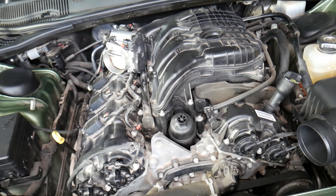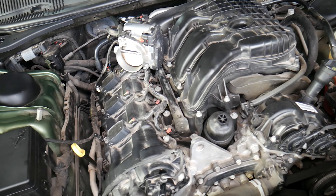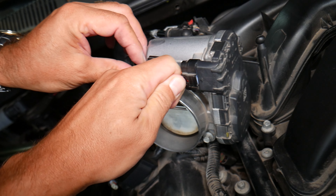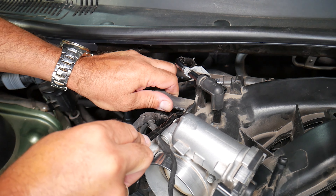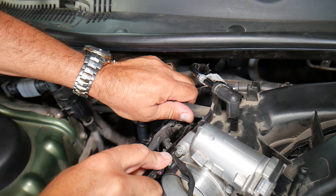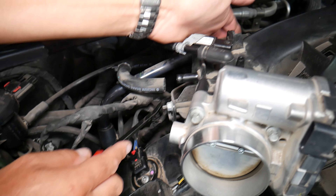We have a few clips that we're going to pry out. Then we're going to start disconnecting wires. That's for the throttle body — press here, push in, release the pressure, pull out, and that wire will come out. Remember where they need to go later. This is a MAP sensor right there — we need to disconnect that one as well. We have one vacuum hose; be careful not to break it, because if you do you'll need to replace the intake manifold, and that could be pricey.